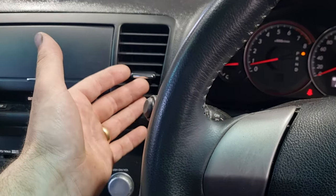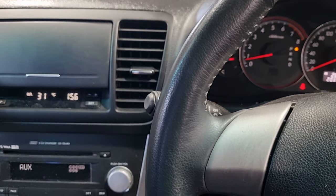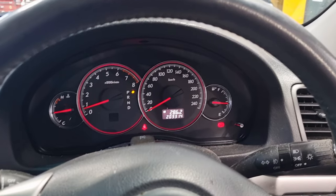There we have it guys — temperature gauge is up nice and steady. I did have the heater on just for a couple of minutes until you can start feeling hot air come out. It's 40 degrees Celsius today so I quickly smashed the aircon back on. Next, you need to let the car cool down — but first check that the bottom radiator hose is hot after a good five to ten minute drive. The bottom one should be pretty warm, the top one should be quite hot — you should only be able to hold it for a couple of seconds. Turn the car off, leave it for about 15 minutes to cool down, then slowly take the radiator cap off and fill the coolant up a little bit more until the radiator is full. Put the cap back on and you're good to go. Thanks for following me on that one — if you learned anything or it helped you out, please consider liking the video or subscribing to the channel. We'll catch you in the next one, cheers.